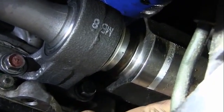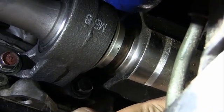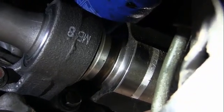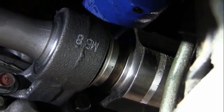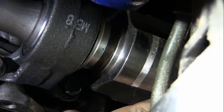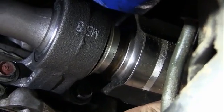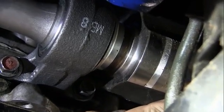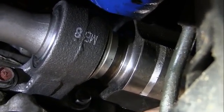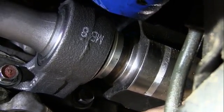Okay, look at all that play where that axle goes to the axle stub. Do you see that play? Well, I think that's the vibration right there. And that's an Acura. The stub, I think the axle isn't fitting that stub correctly. See that thing wiggle? And we can see the axle move when we're rotating with the dial indicator. That inner axle has got a problem, and I think it's moving the whole axle, and the axle is spinning not true. And when the axle spins not true, it's shaking the whole hub.